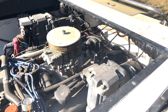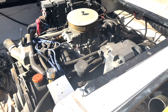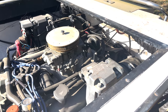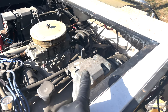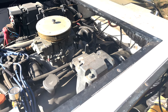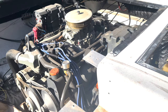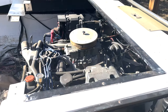One thing to mention — we technically could start this up without the stern drive on, and in some ways maybe it's not a bad idea. There's a water line right about there — you can hook up a hose and water would be pushed into the motor through that little black hose right there. I'm kind of on the fence on whether I want to put the stern drive on first and then start it up. We'll see.